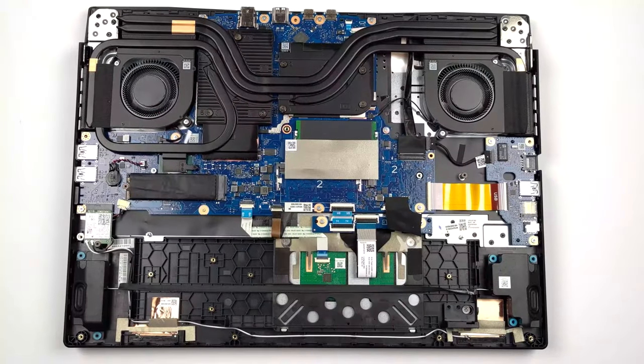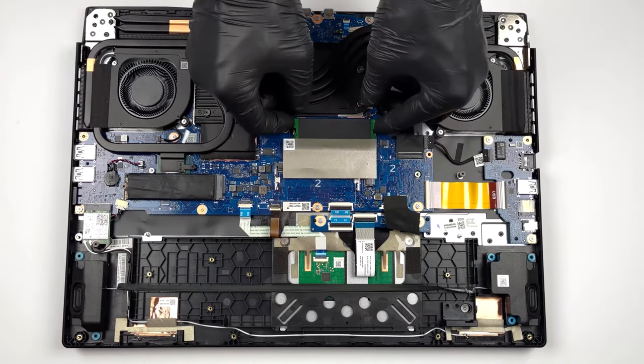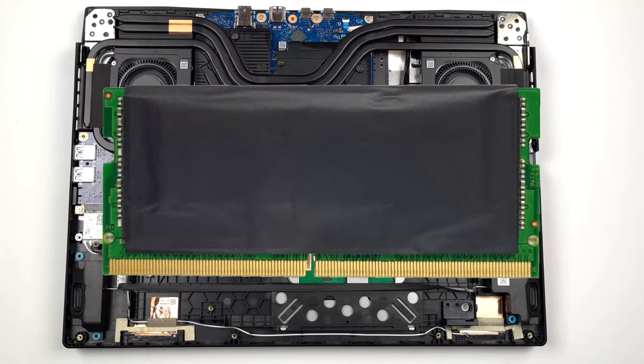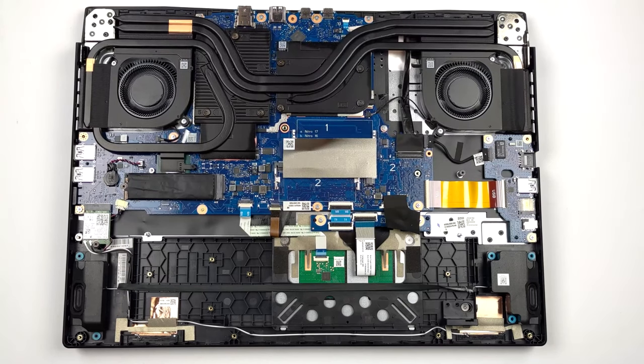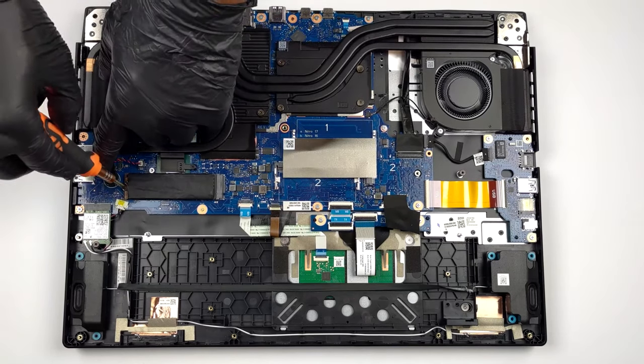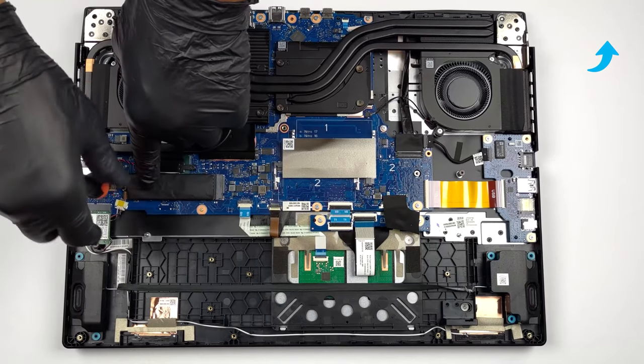While we're checking out the battery, let's focus a bit on the upgradeability too. The laptop has 2 SODIMM slots stacked over each other for up to 32 gigabytes of DDR5 memory. The storage can be upgraded through 2 M.2 slots that support Gen 4 SSDs. For the full teardown video, you can click the card up top or check the link in the description.